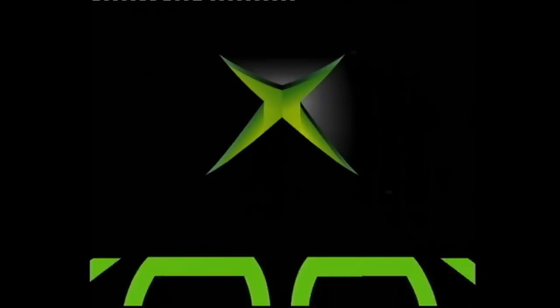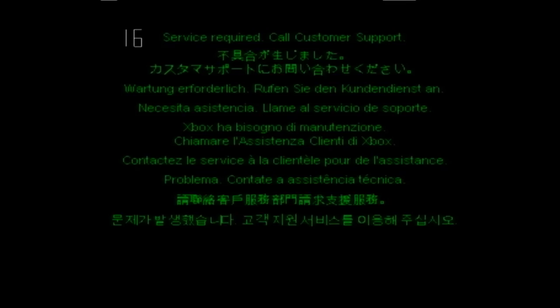So we've now got our Xbox hooked back up with the video capture running. If you just go for a standard boot, you will see that you are about to get a scary error — Error 16. Error 16 basically means that the machine cannot locate the dashboard or the dashboard is corrupt. So you're going to have to reinstall all the dashboard and everything else. That's why you need the chip — you need the ability to boot into a boot disk to reformat the disk and put everything back as it needs to go.